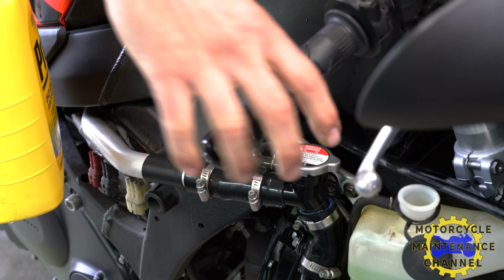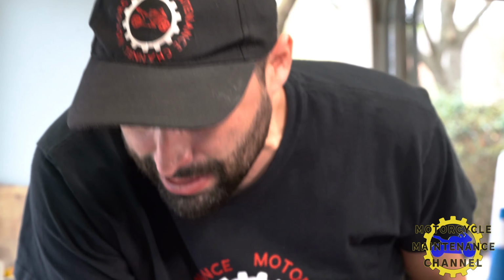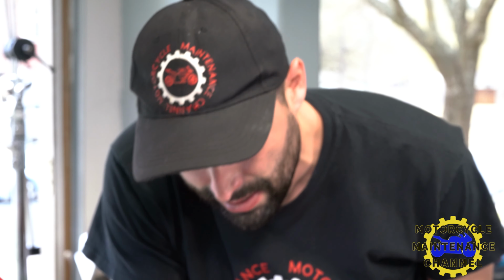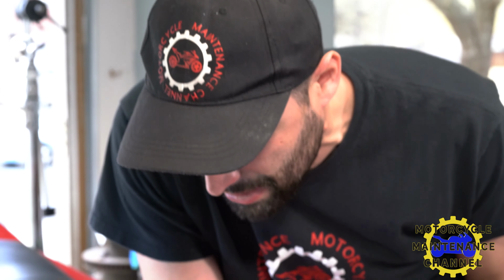We're gonna let it heat up and make sure it doesn't overheat, because if it starts to overheat, that means there's a bubble in it, and that's okay. If there's a bubble, we're not gonna freak out if it starts overheating. We're just gonna turn it off and let it sit. If we freak out, turn it off and pop this off, we're gonna get hit in the face with a bunch of radiator fluid. It's not good. So we're just gonna let it sit and then we'll watch it suck water from the reservoir.